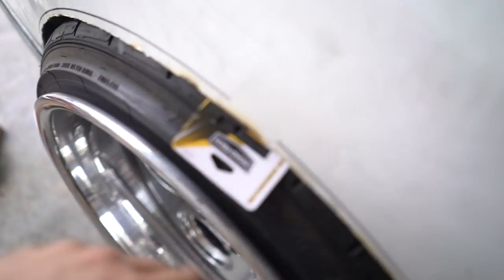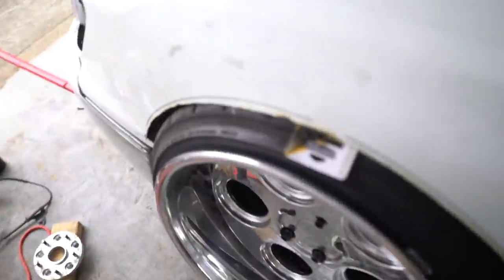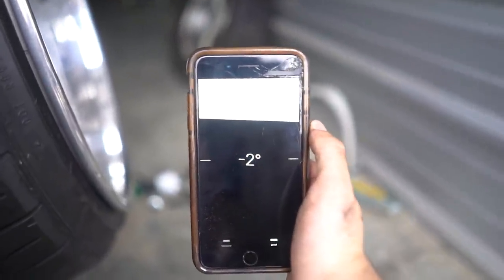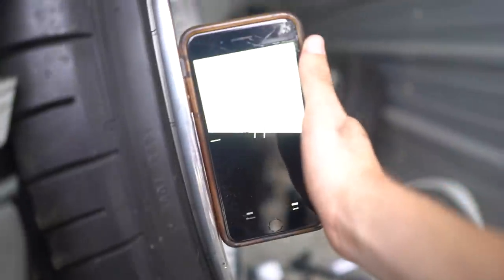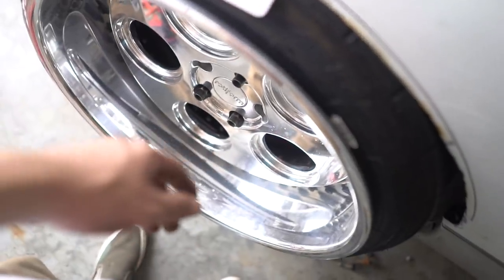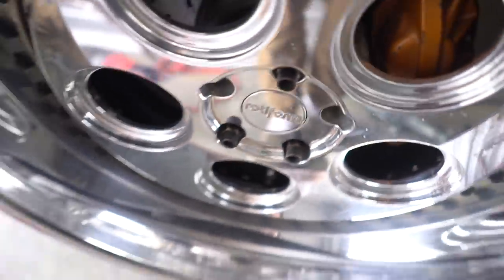That flare is not fitting on that. I pulled the fender out a little by adding this piece in to get the wheel higher. I actually want to measure how much camber that is and see if it's a number I want. Pulling out the old iPhone measure app — please don't ask what camber app it is, it's literally the measure app that's on every iPhone. Okay — minus 11 or minus 12... minus 12 degrees. That's basically ballpark where I wanted the car to be anyway, so I'm not against that.